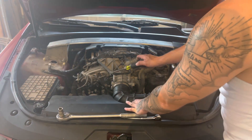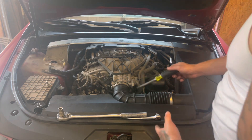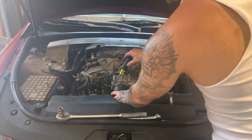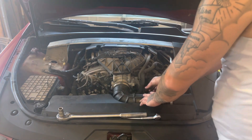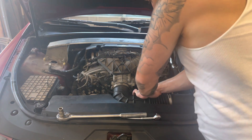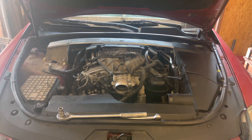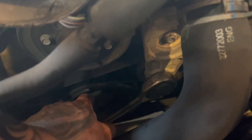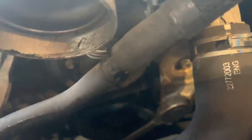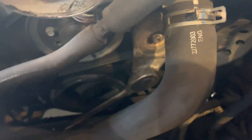Next I'm going to take the screws off my air filter right here and right here. It'll make it a little easier to work in there getting between the belt and stuff. I already loosened it — just loosen it with a flathead screwdriver. You have a plug connected to it, go ahead and unplug that. Put it to the side and it should just slide right off.